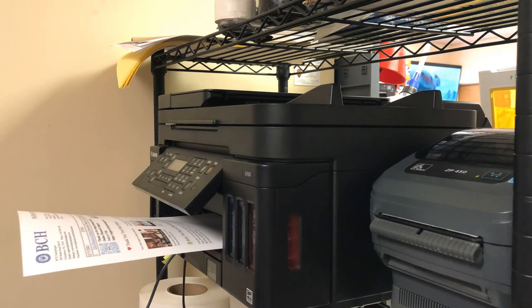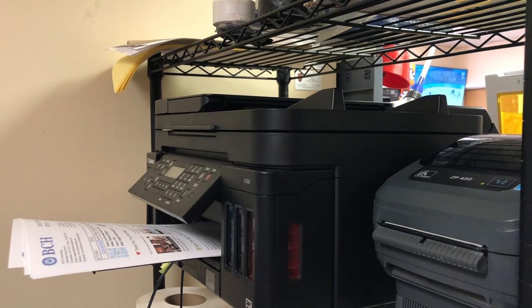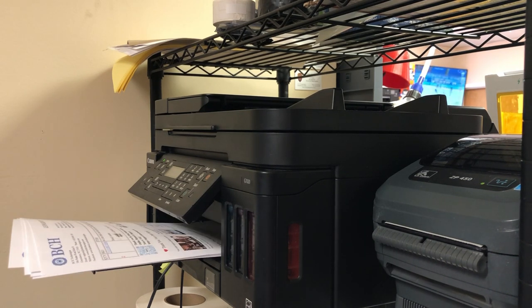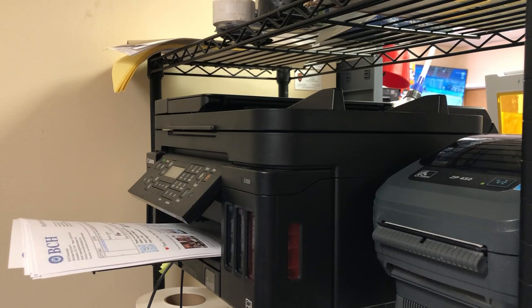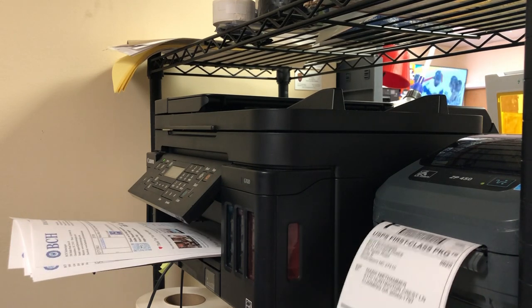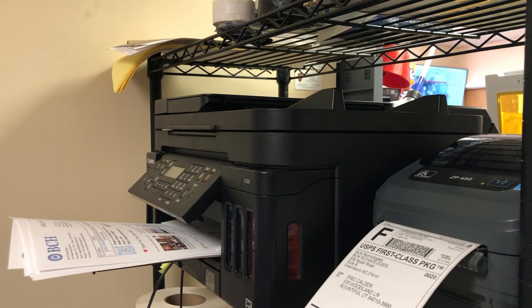After the conversion, you want to print more than you normally would. I print every couple of hours and do it for two or three days — printing like 20 to 40 pages a day. What you want to do is get the printer used to the new ink, and also make sure the old ink doesn't congregate.